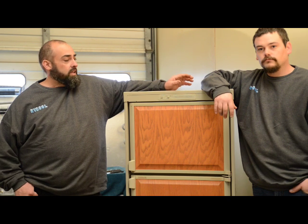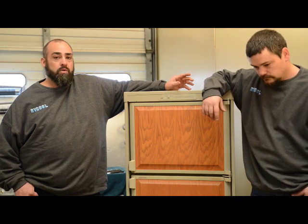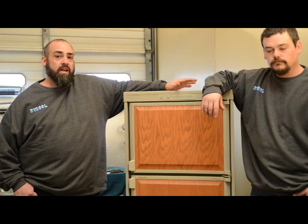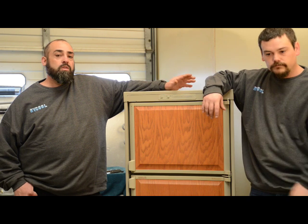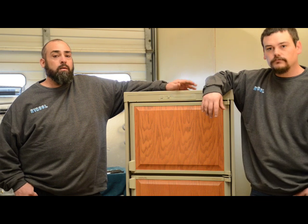So in this video, we're going to install a cooling unit in a Dometic refrigerator. The RM2652 is probably the most common cooling unit out there — your 2652s and 2852s. We're going to walk you through step-by-step everything that you need to know to have a successful installation and show you that most folks with common tools can install the cooling unit themselves with no problem. We're going to assume that you've got the refrigerator already out of the camper. We'll start with the refrigerator standing up. We've got a few screws to take loose inside the freezer and in the refrigerator section, and then we'll lay the refrigerator down and start the removal process.